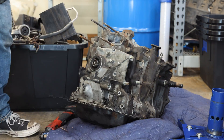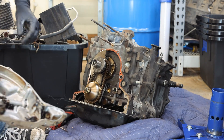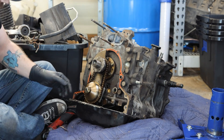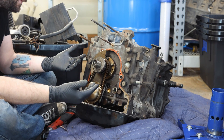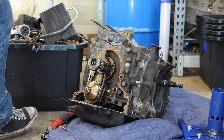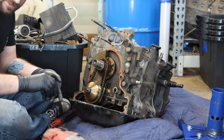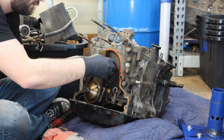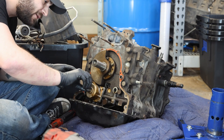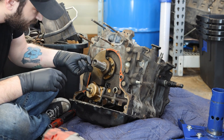That smells like an old engine. It should come right off - just like that. Wow, that's actually really clean inside the front cover. I'm actually surprised. We're going to clean all this up hardcore. We've got this gear here, which is for the oil metering pump - we're deleting the oil metering pump because we're going to be using pre-mix. This is the chain for the oil pump. The nice thing is there's no timing, so this piece will slide off. I feel like I should mark on this stuff like front and back - future Taylor watching this video, keep in mind the F just means front of the engine. The nut's off, the bent washer is off. These gears kind of come off together - there are our oil pump gears. There is a keyway - make sure you don't lose the keyways. There's also a bigger keyway on the e-shaft.